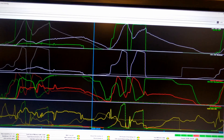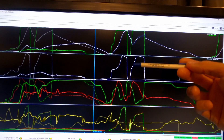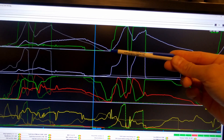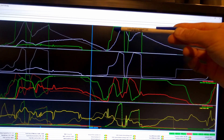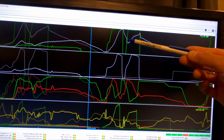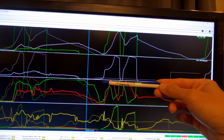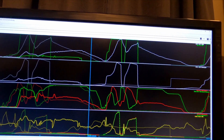I've got my logs pulled up here. The darker of the two graphs is the one where I have the recirculation valve connected to the intake — that's the first run. What you're seeing here is my throttle position; you can see I'm stabbing the throttle. The green is the throttle position, the white is my RPM. That's first gear, that's second gear. Here's my boost pressure in white. You can also see things like spark advance and VVT down here, but really we're looking at the boost pressure, the throttle position, and the RPM.